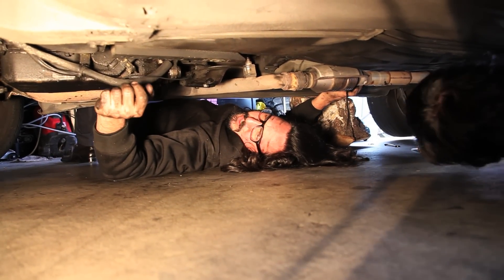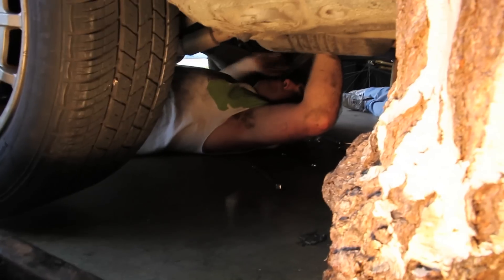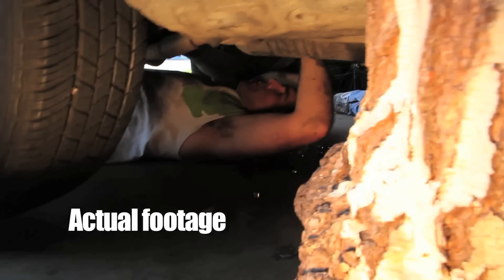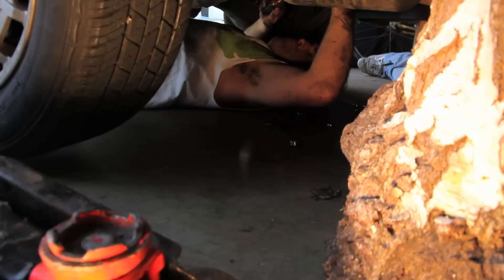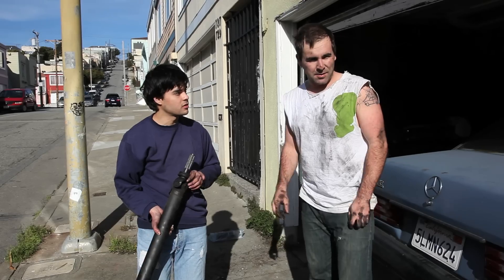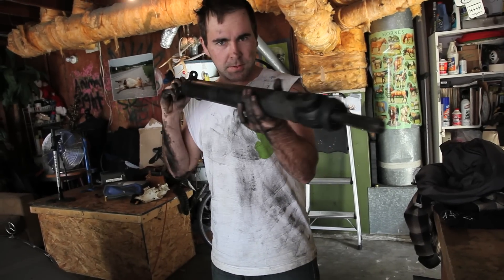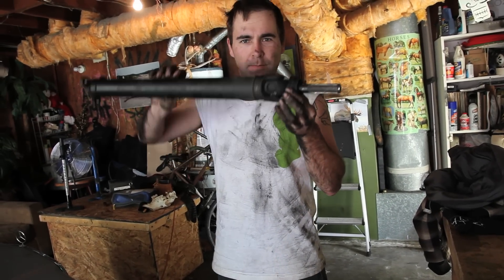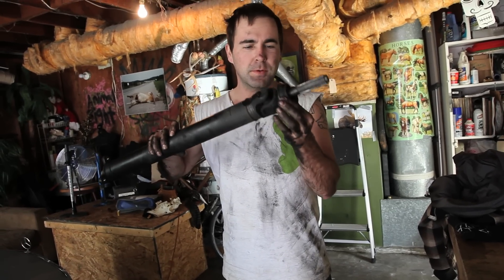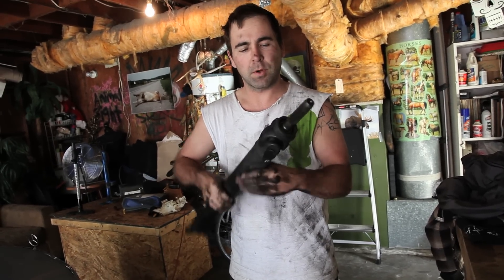You can see that it's ripped away — it's pretty torn, and replacing it is definitely a great idea. It's not going to fall on you, is it? Nope, it's going to fall on me. Now it should slide out of there. We got the drive shaft out. This is the back end of it, and there's a bearing here that supports it while it's spinning. It's mounted in some rubber, and over the years the rubber just shook loose and the thing was bouncing around while Max was driving. We're going to replace it with a new one.